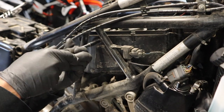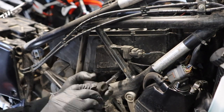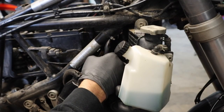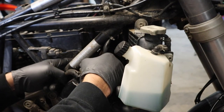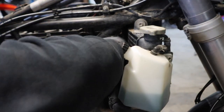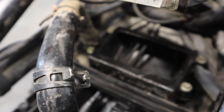Over here on the right hand side of the bike, same thing — we need to remove this triangle cutout using a six millimeter socket. Up here, this is our main fuel injector plug. Mine should have been hung on that tab there and for whatever reason it's not. All we want to do is disconnect this because we are going to have to fish it through the box. The one thing I skipped at the beginning — right where the snorkel should have been I just had that air filter — I'm going to go ahead and pull out those four bolts as well.